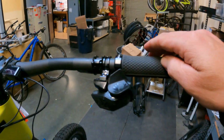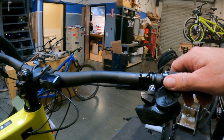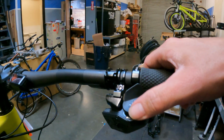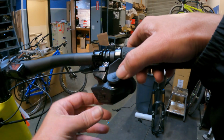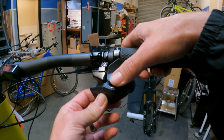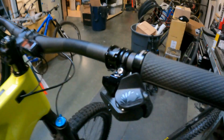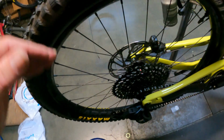So the derailleur will hardly move. So we know that this button down here is going to move our derailleur up the cassette, and that's where we want to go. So we're going to hold the button and hit this 2 times, and that basically did 2 micro indexing adjustments up the cassette.